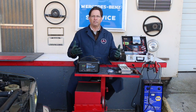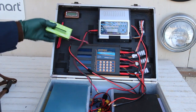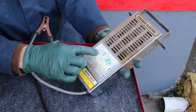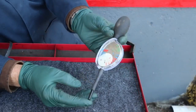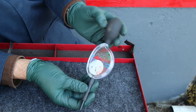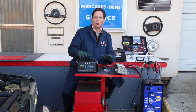I got a hold of — you're looking right here at my charging station for my electric airplanes — and that is very sophisticated compared to something like this traditional charger. Here I'm going to test my battery and put this load tester on it and push the lever. But what's it really telling me? This battery isn't very strong, but is it bad? I can use a hydrometer — it's kind of messy — and it'll give me an indication of the different cells, but it takes a long time. Why can't I just plug something into a battery and find out how the plates are, what's the condition, and how much cold cranking power is really left?